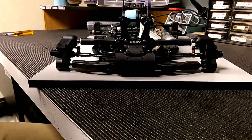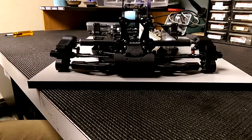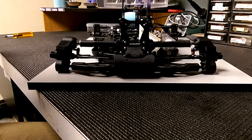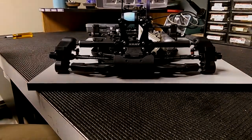And if you ran this car like this, it would feel very stiff when you turn left because this sway bar would be engaging very soon. And then when you turn right, it would feel very soft. That just makes for a very inconsistent feel around the track and it's going to make it harder to drive. This is one of the things that is overlooked by a lot of people, but if you do set it properly, it's going to make a big difference — your car will be a lot easier to drive and a lot more consistent from race to race. I hope you liked the video. Thanks for watching.